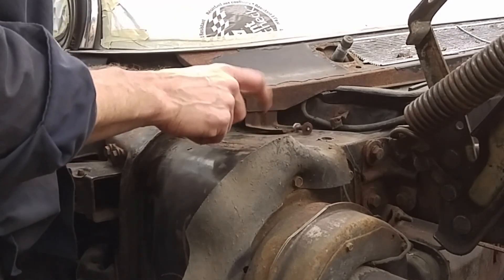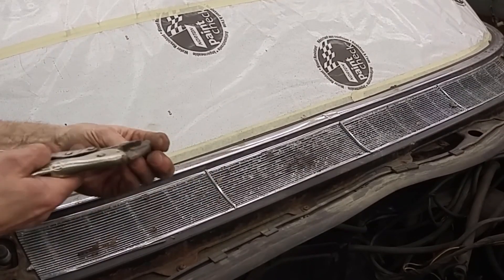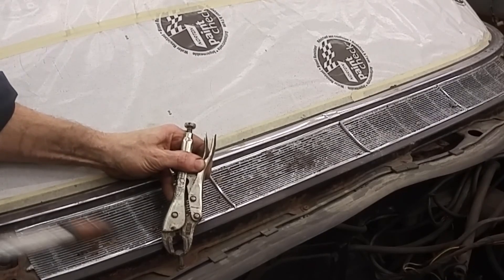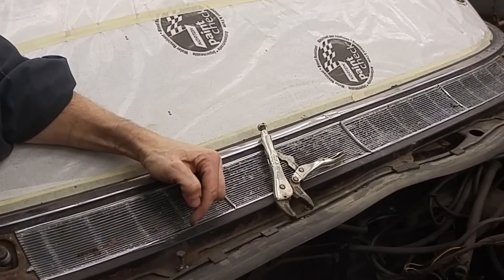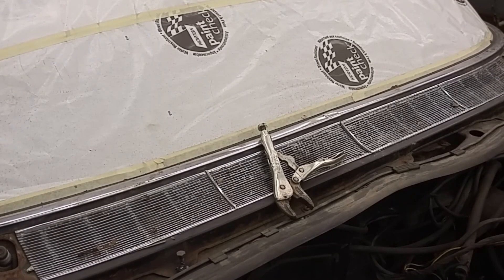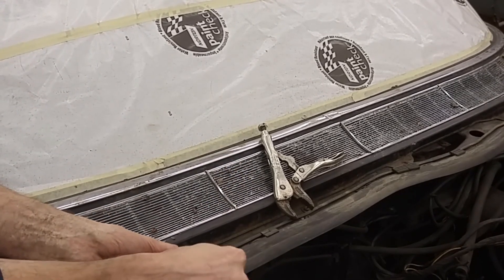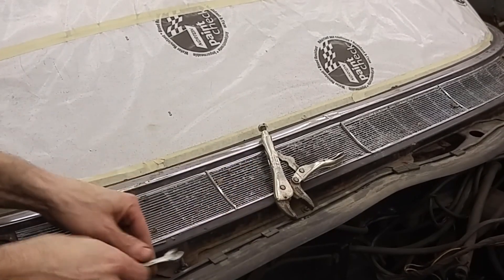So I'm going to get another bolt, prepare it, and try the next one. We've sharpened up another bolt — taking the tip off — and we're going to get comfortable and try welding that to the screw. We'll let the weld cool a little bit; you don't want to try turning a hot weld because it'll just spin right off. And oh, look at that — a little bit of back and forth and we can get that one out. Fantastic.